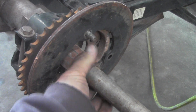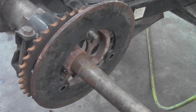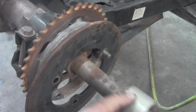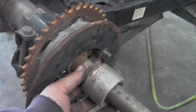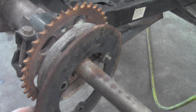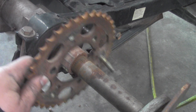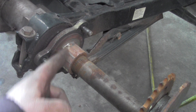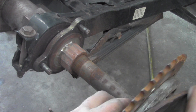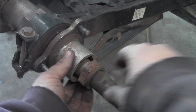Back that nut off. I did it earlier just because I needed to get a screwdriver behind this collar — heat it up, get a screwdriver behind it. So I ended up taking the chain guard off, the spacer and the sprocket. That gave me space to get a screwdriver down behind this collar.